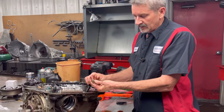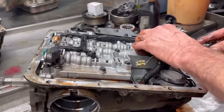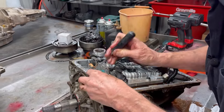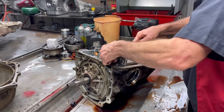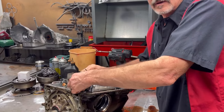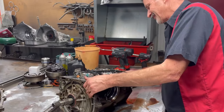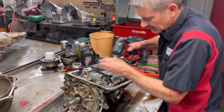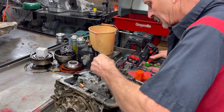It is a late version — it has a lighter plug. Now the pressure control solenoid is missing too, so we don't know what's going on here. A core is a core. But I don't see a lot of shavings or anything like that — that really looks good. I don't see it all contaminated through the valve body stuff, so that's a plus.